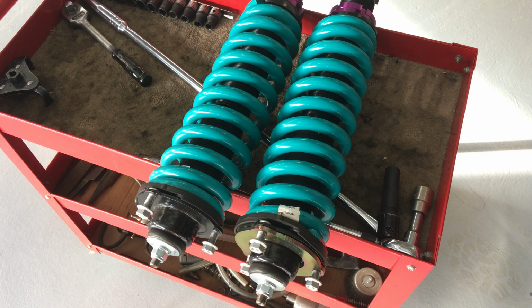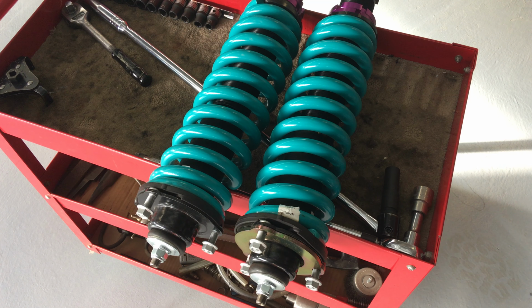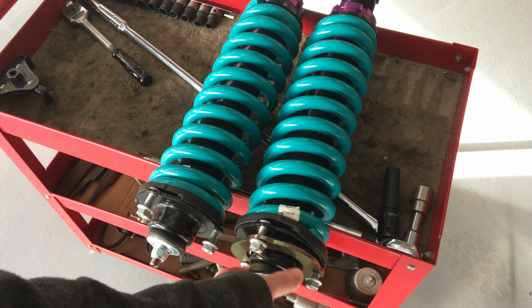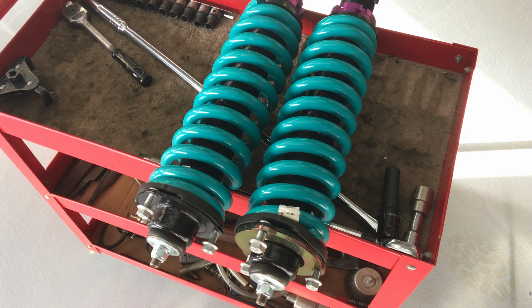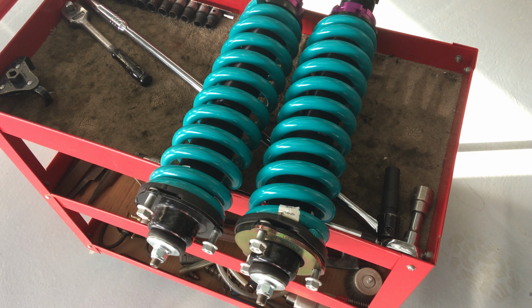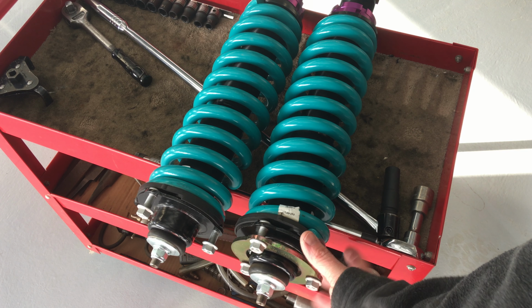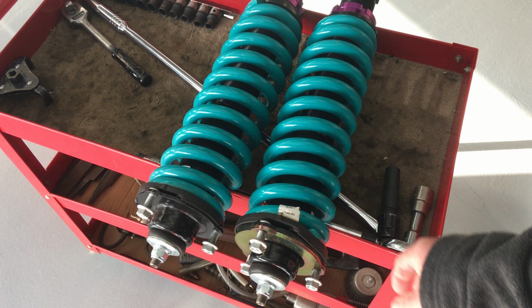So obviously, normally when we talk about a strut spacer, that's this here, right? So we've got one installed on one strut. That's your strut spacer. The manufacturer quotes that as 5 millimeters. A 5 millimeter spacer gives you 10 mil of lift. So let's quickly explain that so that you don't make the mistake of going, oh, I want to go 20 mil higher, and you put a 20 mil spacer in, because it's around about double whatever the thickness of the spacer is. It's around about double, okay?